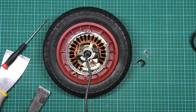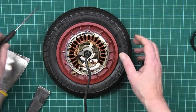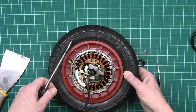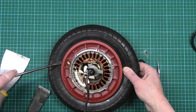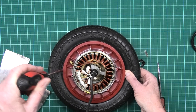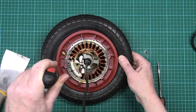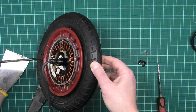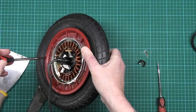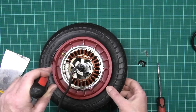Now I can take the tire off after I've let a bit more air out. When you're taking tires off, what you've got to do is push — if you pinch that in like that. I've shown you this before. Obviously use proper tire levers. What you'll notice is as you're pushing that in, as you're squeezing it, the tire moves — it goes into a recess that the tire actually goes into. You want to pull the tire into that recess; the only way you do that is squeeze it flat like that.